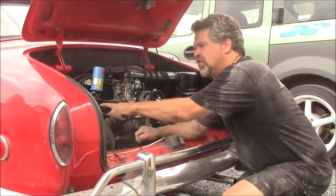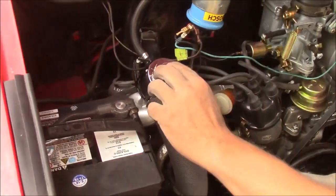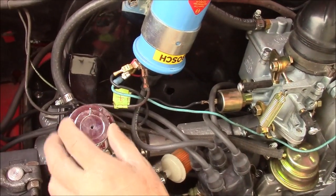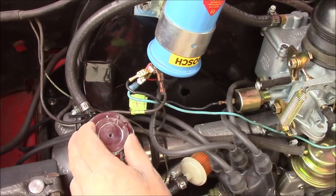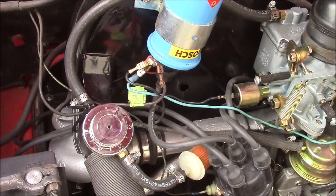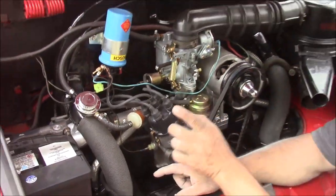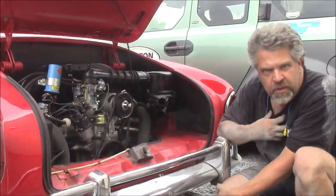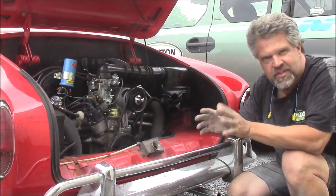It has numbers on the dial. It starts at half PSI, and you can see this little arrow. So it's adjustable. You push down and it's spring loaded. So the first increment is half a PSI, and then you see the number 1. So that's 1 PSI. Most Volkswagen air-cooled engines, people will suggest that it should be happy at 1.5 PSI for fuel pressure. Our experience, and my opinion, 1 PSI seems to be the answer.